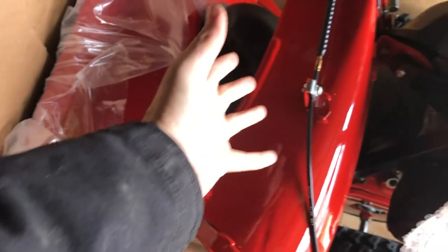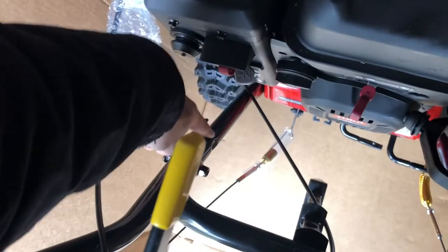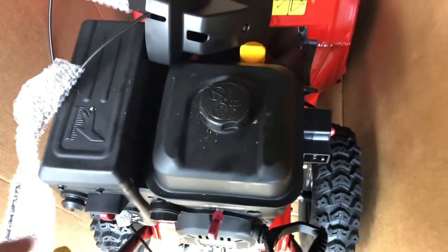So what I did is I came to the back end — here's where all the snow comes in. I knocked out the box. What we're going to do is lift this up all the way, find the corresponding bolts that go into here and here from that bag I just showed you, tighten them, and then pull it out of the box from there. Now we've got those in there — we're going to tighten them up. It's a half-inch socket.